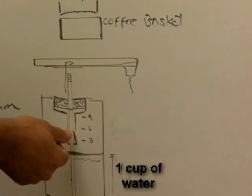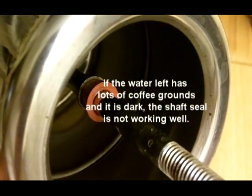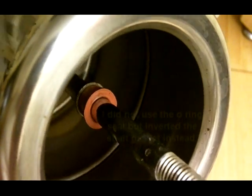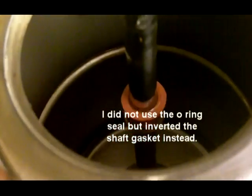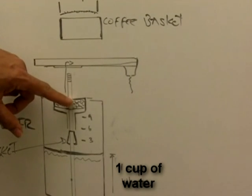After I experimented by adding an O-ring at this point to seal against the lower part of the filter here, the coffee started to improve. Parts per million got to be about 1,650. I have a meter to measure that. And then I decided to also create a seal here.